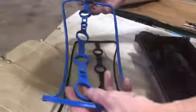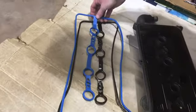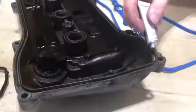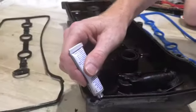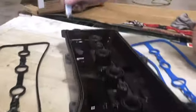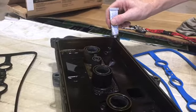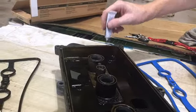Here's the new gasket — looks to be pretty close to that one. Just in the corners I'm going to put a little bit of sealant. There's debate on whether or not it's really necessary, but just a tiny bit in the corners couldn't hurt anything for when we put it back in the engine. Don't want to go too crazy — it'll just help keep it in there.